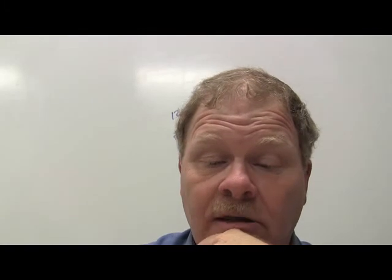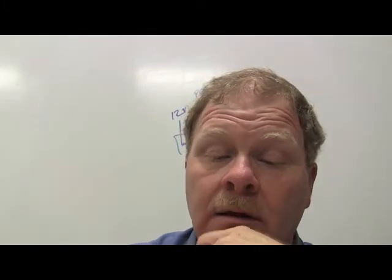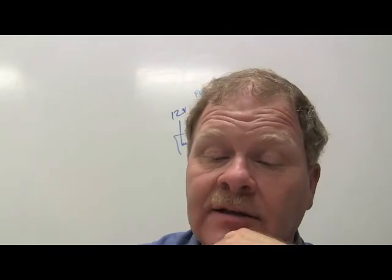All right, let me see. Number 10 is basically going to be C. A contaminated sensor could be the cause too. If it's got a bad heater, then it's not going to get hot, and they would get a P0133 on that. Of course, you'll usually get a code for a heater too.